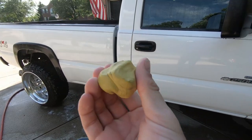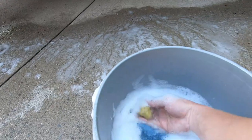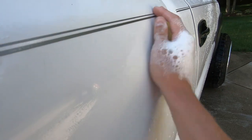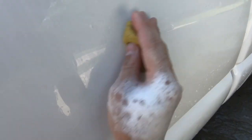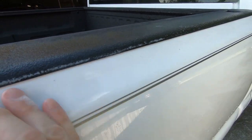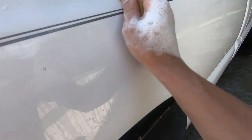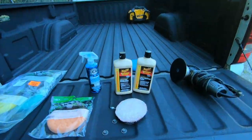First thing to do is grab your clay bar. You're going to do this step while washing your car or truck. Dip the clay bar in your soapy water — you want the surface to be wet — and just let it slide on the surface with barely any pressure. You don't have to work it into the paint. It'll take off little rust spots and contaminants like that, make your paint feel really smooth afterwards. Take it over the entire surface to get your paint ready to buff.